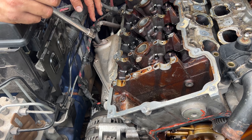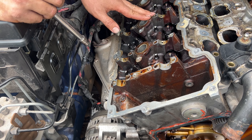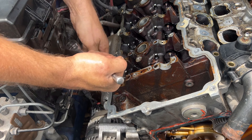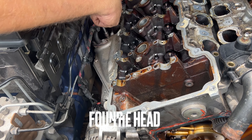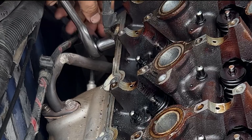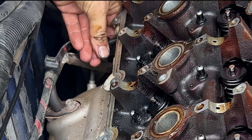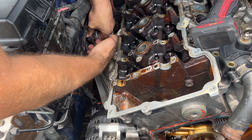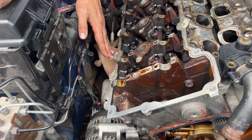There are a couple of ways to do this — you can take the head off with the exhaust manifold, or unscrew the exhaust manifold from the head separately. I prefer to take off the exhaust manifold separately so I can put a new gasket on. It's extra work but it will eliminate future problems. We also have a little ground connection here — half inch — and once it's separated I'll put that bolt right back.